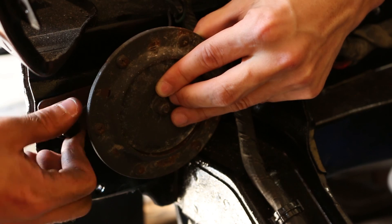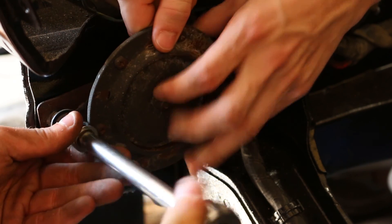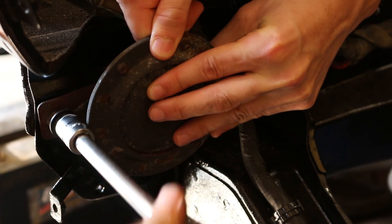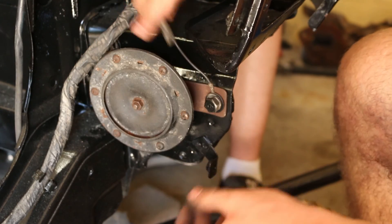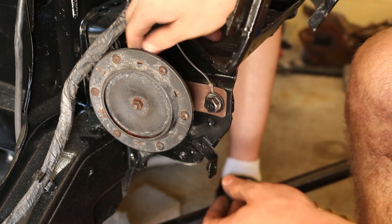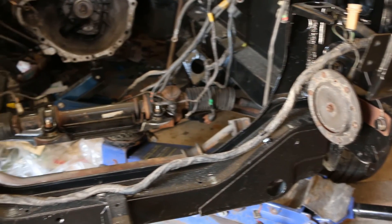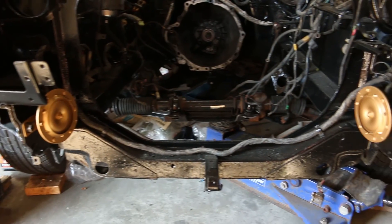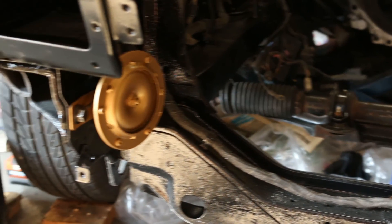So next you're just going to want to test fit everything. Put your bracket bolt in — you don't have to keep the grounding wire in at this point because we are just making sure everything lines up and fits. On this side I went through and did that just to show you the finished product. At this point you're going to want to bend the brackets any way you need to so they're not rubbing and touching on everything. After that, go through and paint them if you want, or leave them as they were — at that point you're pretty much done.